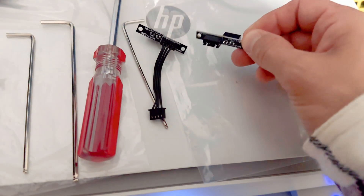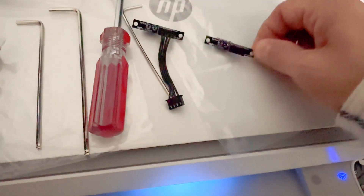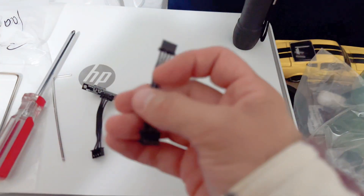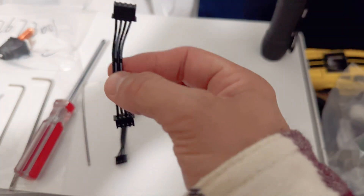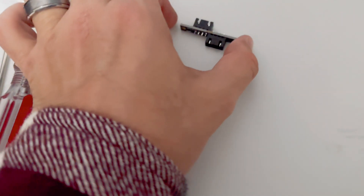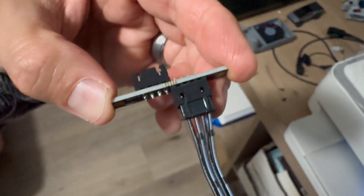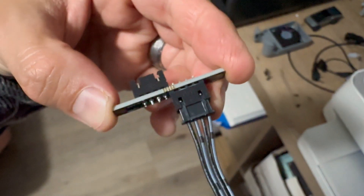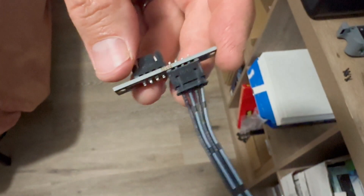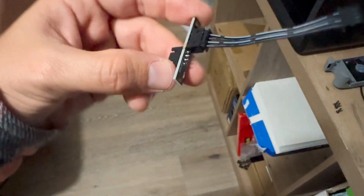What I'm going to do is match the new cable up to how the old one is oriented. It looks like it goes that way — yep. I'm not sure if it's on Amazon; I'll put a link in the description if it is. If not, you're still within warranty — I would ask for this cable and the interface card as well. You have oils in your fingers, so hold things by the ends and do not touch it directly. With the two lines facing up, push into the connector that way. Put your thumb behind the plastic on the other side, push in hard until you hear it snap and it's flush — that's what you want.